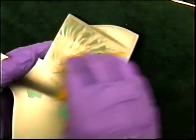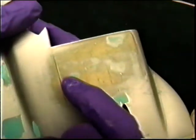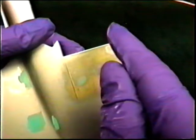Again, this green cat, I should say, instead of putty, sands so quickly that the feather edges in. And what you're looking for here, let me show this, in all parts of a good repair or a good finish is the feather edge. See, that's a feather edge where it just disappears. It doesn't have a step.